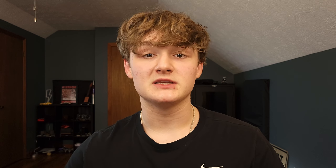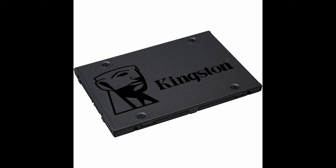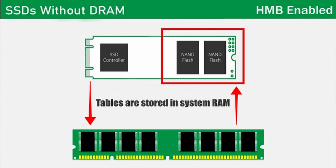Your saves disappear unless you manually back them up, but I didn't have any saves. Online, there's a lot of people who argue for and against this. The PS3 is equipped with a SATA 1 drive interface, meaning it only has a maximum bandwidth of 150MB per second. Modern SSDs can blow that out of the water, so you won't see the full benefit you would on a more modern system. There have also been reports of some SSDs causing errors, slow speeds, and worse overall performance. For my purposes, this cheap Kingston A400 works, but eventually I want to upgrade to a 1TB SSD with an actual DRAM cache, because cache-less SSDs are not only slower but last way less long.